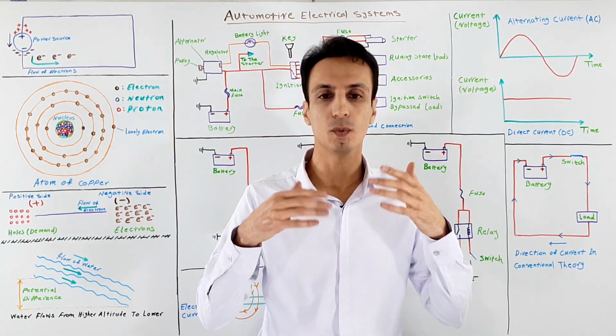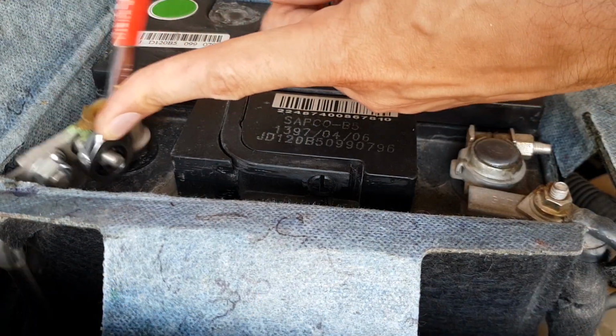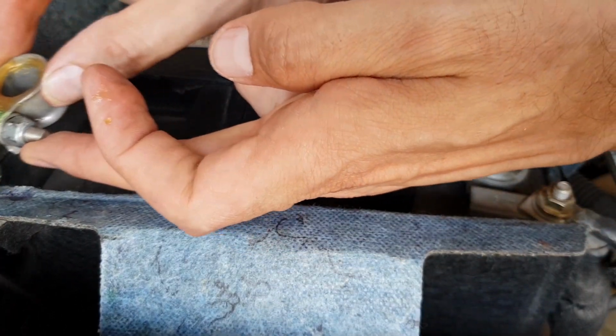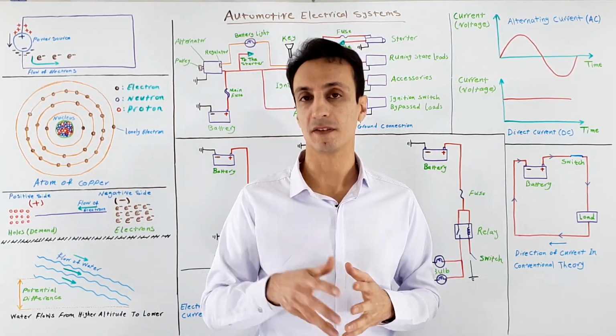And remember that when you want to work on electrical systems, wisely remove the battery negative connection, or to avoid ECU's memory loss, you can neutralize that system by removing the related fuse for that circuit. Not following this precaution can cause sparks, blown fuses, and then can make a fire.